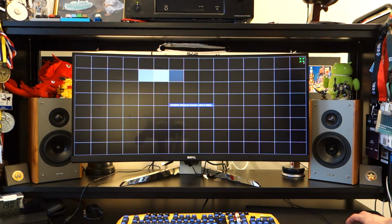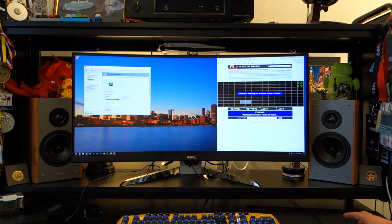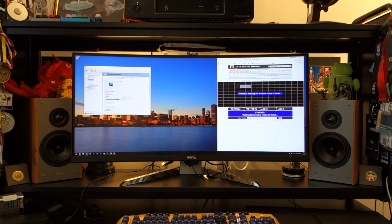And it is absolutely noticeable when it comes to games. It's definitely something that you should avoid. So if it was me, if I had an NVIDIA card like I do right now, I would set it to 96 Hz. You're only losing 4 frames, which is not a big deal, and you will avoid any frame skipping, and you'll be able to enjoy a relatively fast refresh rate.